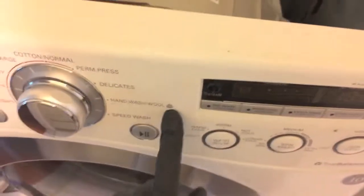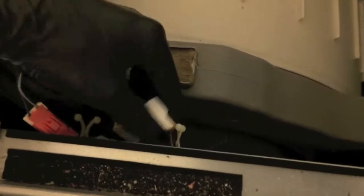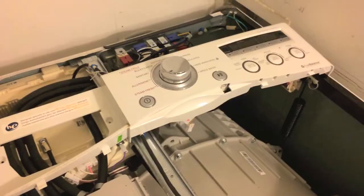Since we are here, go ahead and disconnect these two electrical connection points because we are going to pull the face off. Locate the plastic prongs — be very careful and patient when you remove these. Take off the face plate. As you pull it away, maneuver the electrical wires, as those come with the face plate through a hole. The face plate is now removed.